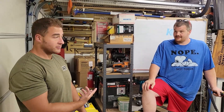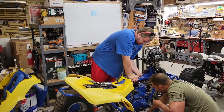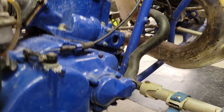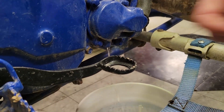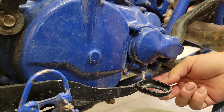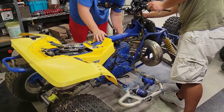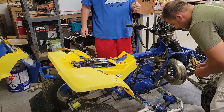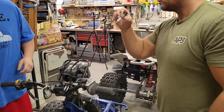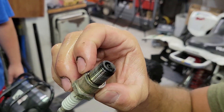I've never ridden a Quadzilla - John's ridden one once or twice. They're torque monsters. Oh dude, this looks like it has water in it. Check this out - that looks like just water. It's not oily; there's very little but it's probably residual from before. That's water - I can smell that. That's bad looking. Wow, it wasn't leaned out. That makes me nervous. The plug looks good - looks rich, no lean spots at all. It's black and it's wet too. That's a bad sign.